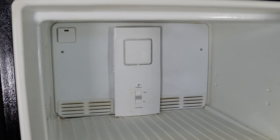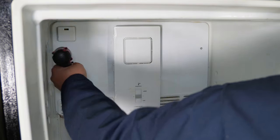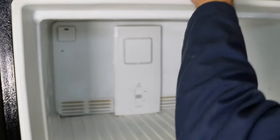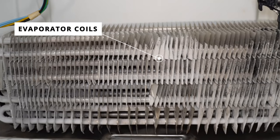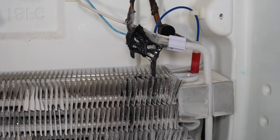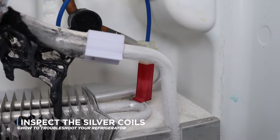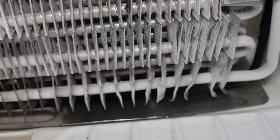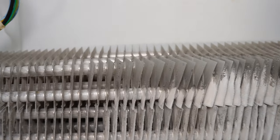But let's say both systems are too warm and not cooling well. Let's go ahead and take the panel off in the freezer. In most refrigerators there are two or four screws holding the panel in place, varying from model to model. With the panel off, you should see silver coils that make the system cold, as well as an evaporator fan. One of the most important things you can do is inspect the coils for frost and ice. If there is a ton of ice — totally packed in snow — it can't exchange heat for cold at the coils, and chances are you may have a defroster problem, not a Freon problem.